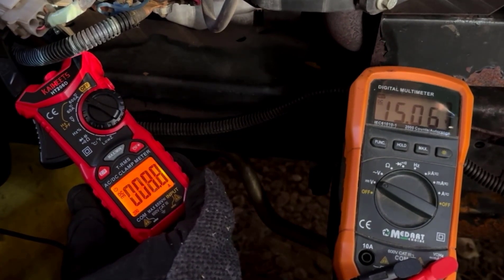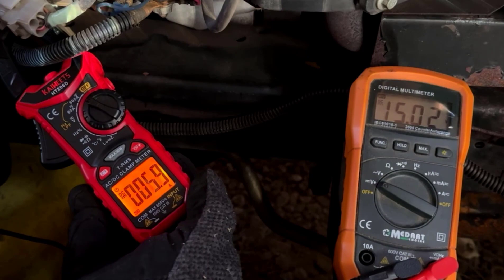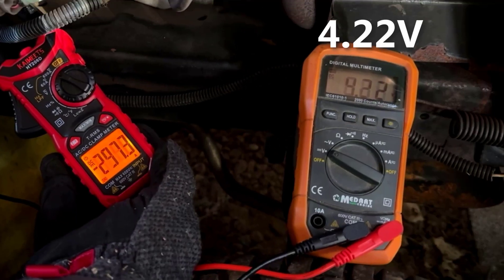It sounds pretty terrible, with an obvious misfire, lifter noise, and maybe an exhaust leak, but it did start without much drama. The starter stalled when initially engaged, and we can see a massive 297-amp peak, with the battery begging for mercy at just over 4 volts. This certainly is not normal, but these aren't optimal conditions with components in tip-top shape either.